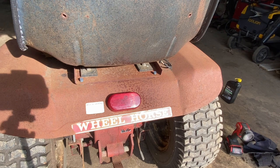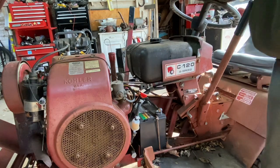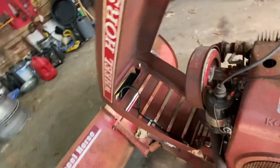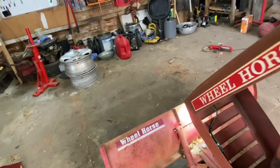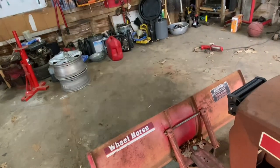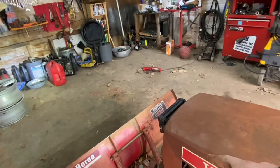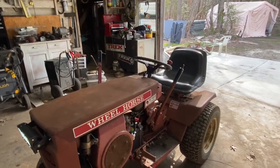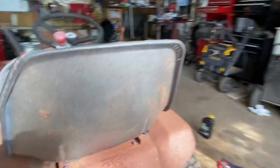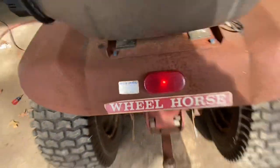Now once I get that gas tank grommet in it'll be good to go. I greased up the front end too. Instead of ordering a new grommet and waiting, I just took one off another mower I'm fixing and I'll get another one for that. The light bar issue isn't the bar itself - it's the wiring. He grounded it to the hood, and as you move the hood it makes and loses the connection. Don't ground things to your hood - it's not secure. But once it's closed it's good enough. I also found how to check the diff fluid - there's a little dipstick right in there - it was at the right level and didn't look too bad.